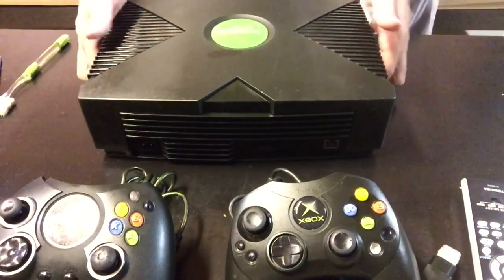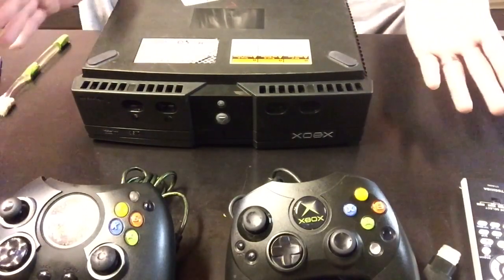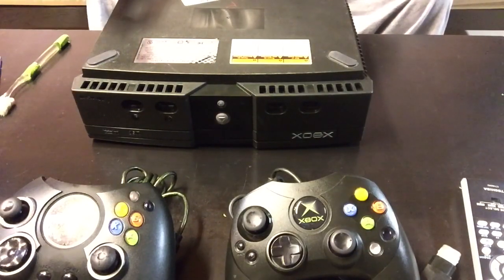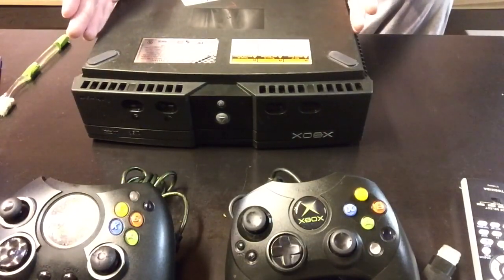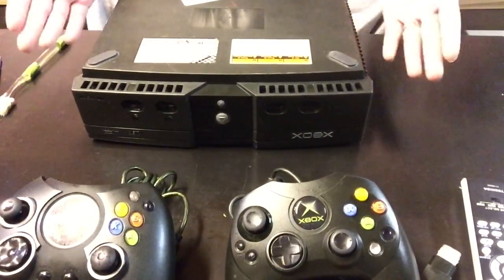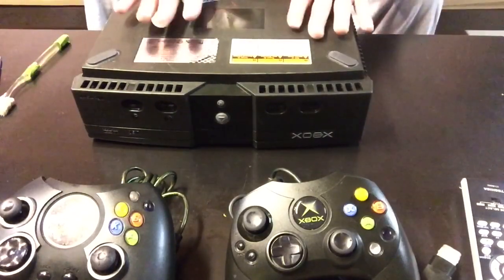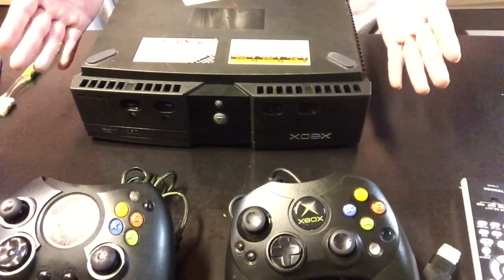You can take it apart — it's not that hard. Under each footing there's an allen key. I'll probably take that apart and give it a nice blowing with compressed air. There are six allen key screws all together. This one has already been modded. While this is drying I'm going to take the top from the bottom and maybe use a vacuum to get any dust inside. I don't love using the vacuum because there might be static electricity, and static and electronics don't mix — so compressed air would probably be your best bet. You can wash the shell with soapy water, but that's up to you if you just want an aesthetic look or a thorough clean.